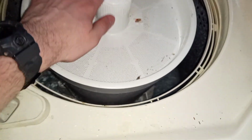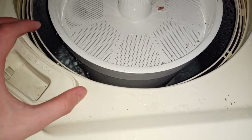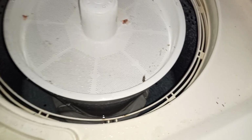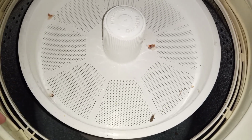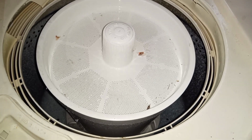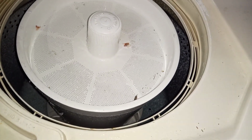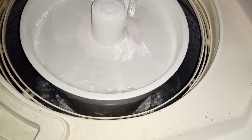Didn't you say you had a fabric softener cap as well? Yeah. Those were interesting. They work the same way as the Maytag. Oh, right. I mean, they all work on centrifugal force. That's how they all operate. Frigidaire in the Multimatics did it a really weird way, and it's really cool. How is theirs? When it was spinning out, they had a magnet that was slightly off center. And when it spun, it would spin the magnet out, which would release a trapdoor at the bottom, but the fabric softener would stay suspended because of the centrifugal force. But when it stopped, it would flow down. It was a really neat idea.